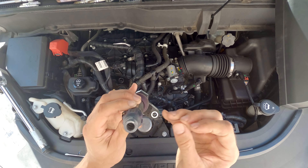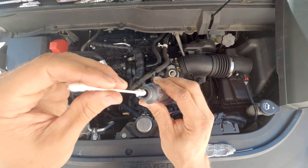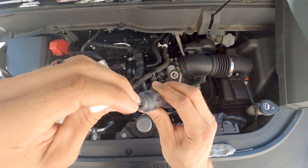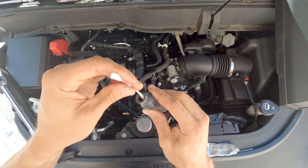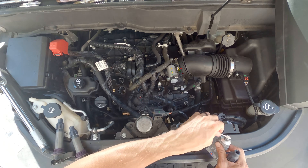Next, it is time to clean up the rubber boot on all the coil packs and apply a thin layer of dielectric grease to the inside of the coil pack boot. I found this easiest to do with a q-tip. Only put the grease at the end of the boot and not at the back where the coil pack connects to the top post on the spark plug.